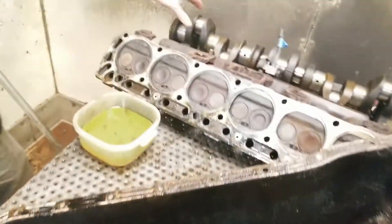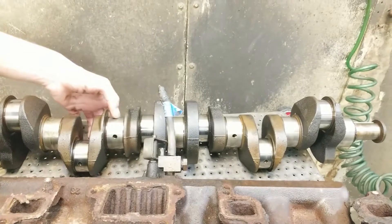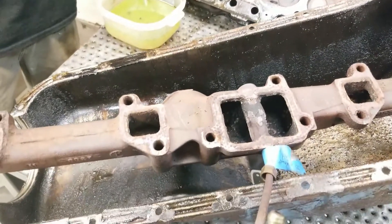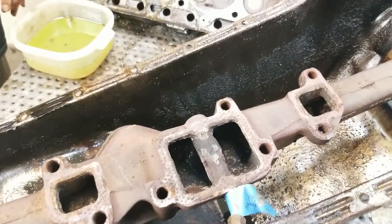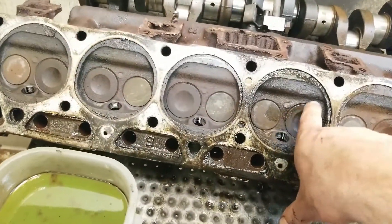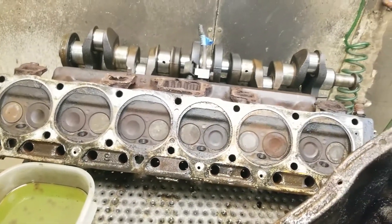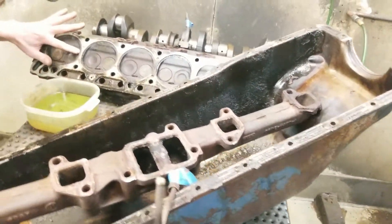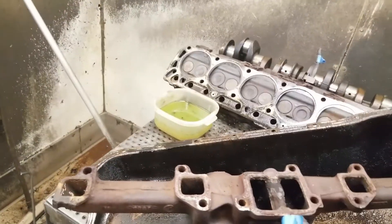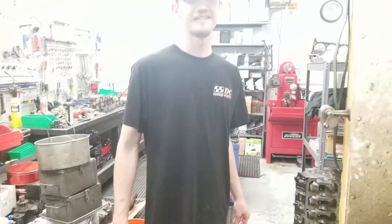Basically a very light polish and that main journal would be fine. The exhaust on the other hand was disgusting — just full of rust and deposits — and the valves weren't sitting on their seats very well. No wonder I couldn't get this engine to start; there's no way I was getting good compression. But overall it's very clean for a motor that was stored in a barn without being properly prepped for storage.